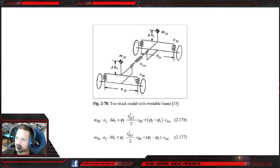And so what we were talking about before is the ride heights in the front and in the back, and how much weight you're going to put in each one. And the ride height in the back is, if the front rolls over a certain amount, and you have a certain amount of weight in front being pulled over, that's affected by how high it is. So real simply, it's a multiplier. So if you have 1,000 pounds up front on this front axle, and you're going around a turn at, say, 3 G's, that's 3,000 pounds trying to be thrown over to the outside of the car.